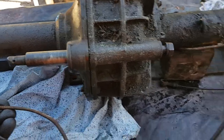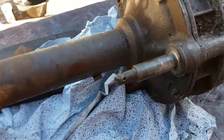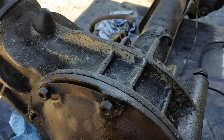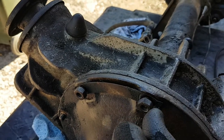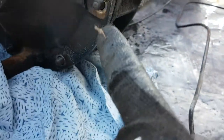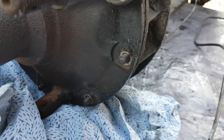So what we did was get rid of the brake line first of all and take that out, then started to go round and undo all the bolts. There are three sections that have tab washers that are bent over, and then you'll find there's one small one that's left on its own with its own little tiny tab washer, so you'll also need to remove that.